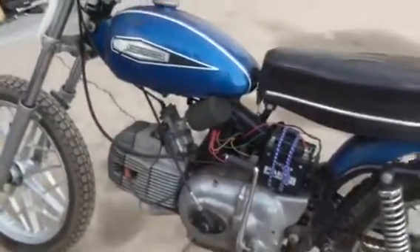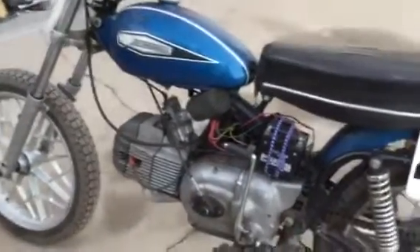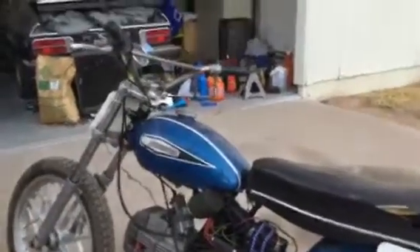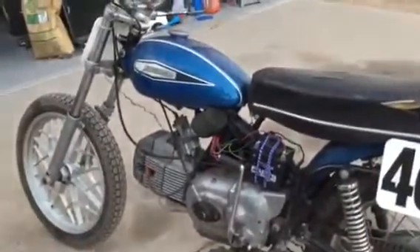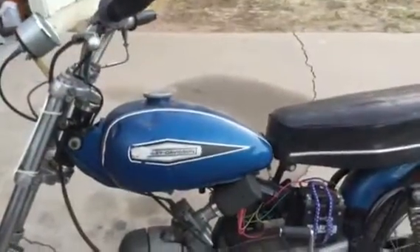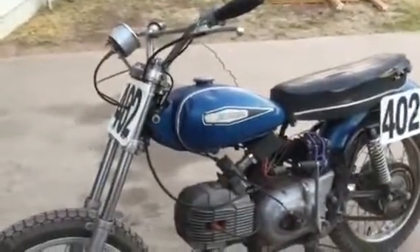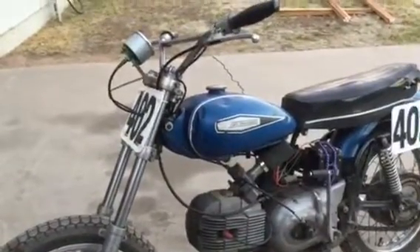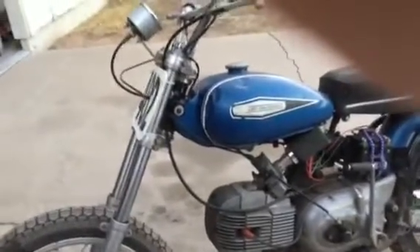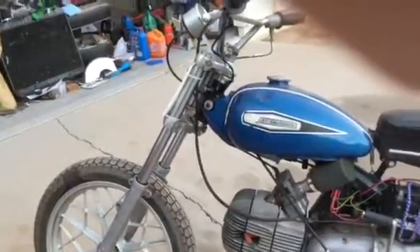The problem is during practice the weekend before last, I took her out and she ran great — stumbled a little bit on the top. I assumed it was because the battery was going dead, and I still think that was probably the case. Went back to the pits, swapped the battery out, put the new battery in, started her up and she ran great for 15 seconds and then started making a lot of metal clattering noise, so I shut it off.